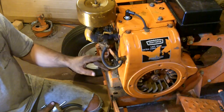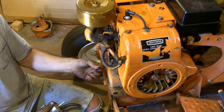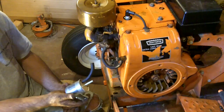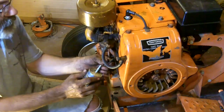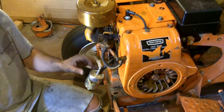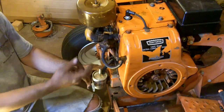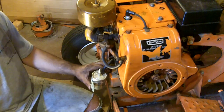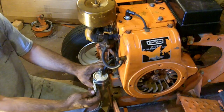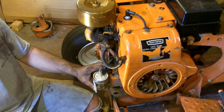So I don't have a pump on here, so I need to do something about this. Otherwise, oil ends up coming out of here. It's not a lot of oil, but a little bit of oil keeps coming out of it, and it'll just make a mess if you don't do anything. So what I do for these is I just use a fuel filter, put the fuel filter on there, and this way it'll push oil into the filter, but then when the suction comes back, it sucks most of it right back into the engine instead of it just being sprayed everywhere. This doesn't need to be plugged up. That's fine to be wide open. And when the grill is back on, I'll attach this with one of the bolts that holds the meshwork onto the grill. That'll take care of that issue and stop it from spraying oil all over the place.